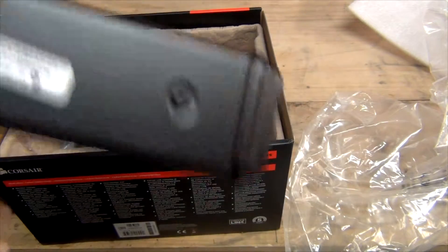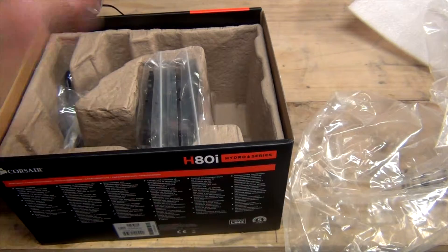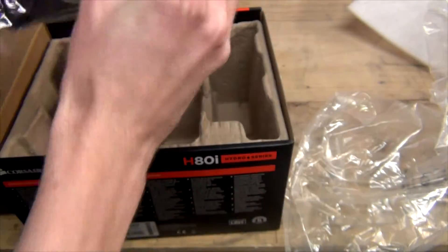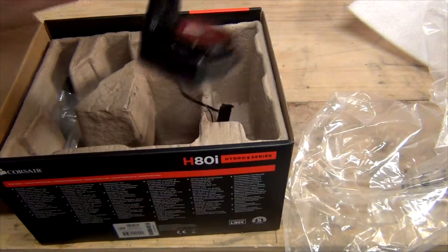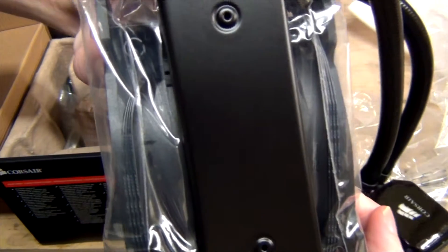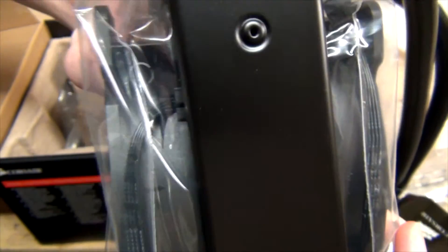You can see the basic little sticker on the front. We've got the standard mounting screws to mount the pump, which remains standard across Corsair's range. Then we have the two Corsair SP120L pressure optimised fans, which will sit on either side of the radiator. In terms of actual thickness, the bulk sitting over your motherboard is going to be considerable. So if you have particularly high memory modules on the X79 platform or the memory placement is a bit off, or extra fans and hardware at the rear 120mm mount position — where this is traditionally mounted — do be aware of that before installing the H80i.